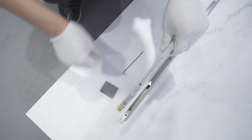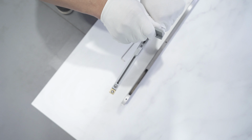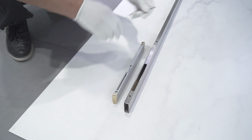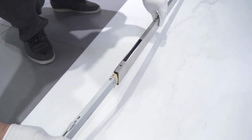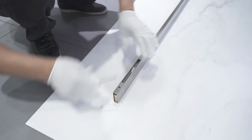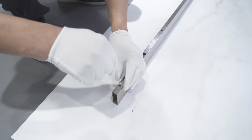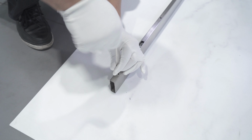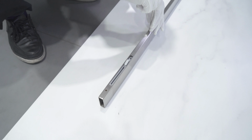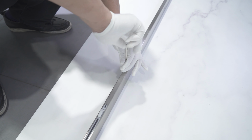Next, take the new soft close mechanism and reset back to the center. Next, insert the new soft close mechanism into the support bar, making sure that the screws are pointing to the side of the support bar with the holes. A long tool may be needed to push the mechanism body all the way to match up with the holes. Align the set of screws with the holes, once again using the 3mm Allen key to find the head and screw clockwise until they are fully tightened.